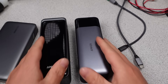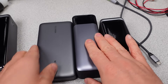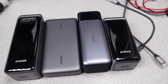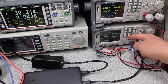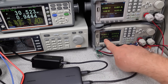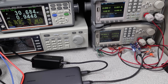The voltages all stayed within the tolerances of the USB Power Delivery specification, which is nice to see. These power banks had general compatibility with any chargers I used them with. Another advantage is they will both charge very slowly but still charge even with an old 5-watt USB-A brick, which is great. I also checked the UPS capability — that is, uninterruptible power supply. The Ugreen was able to keep the USB-C port operating during multiple functions on the other USB port, so this can keep going even when the power goes out on that other port. The issue is the power bank can still deplete itself since it allows more power to flow out than in — it only charged at 30 watts. So it isn't really a UPS, but if you want to keep power going for a project, this will probably work.